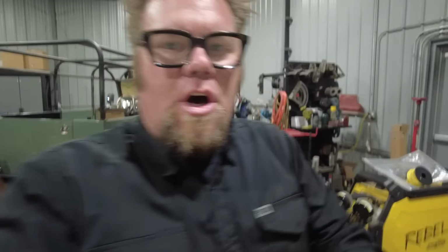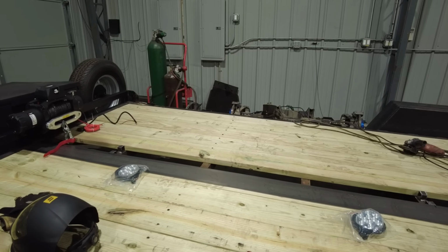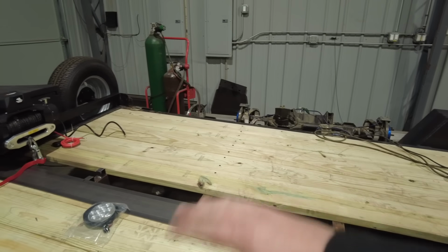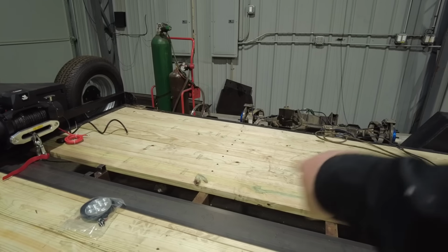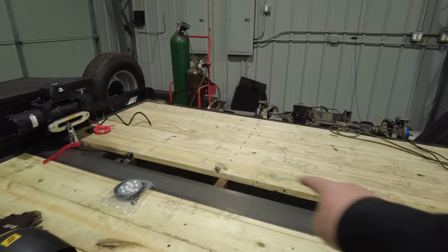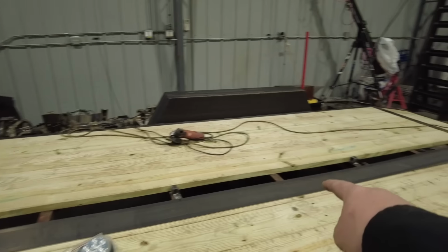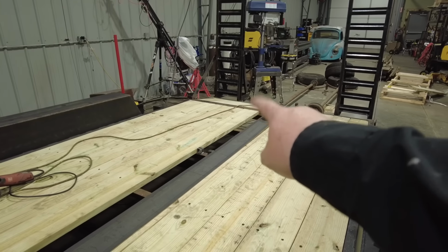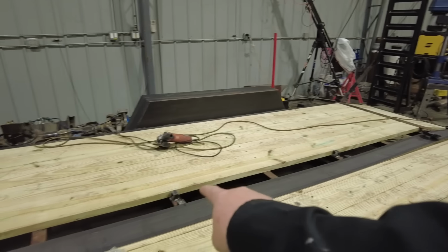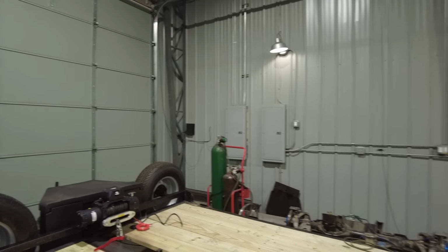So when you put the wood on these trailers, it's never the exact width to fit a perfect amount of board. So you end up having to trim one board. Now, most trailer manufacturers trim the last board so it looks a little goofy. I decided to leave the center open and then decide if I was going to add a board. But instead of adding a board, what I'm going to add is this entire strip of 1/8 inch, I believe this is 6 inch wide, so 1/8 inch by 6 inch wide steel, and it's going to plug weld down on top of these little stanchions that I've already put in place. Now, the reason I am doing that is twofold.